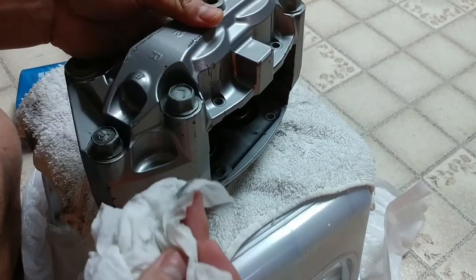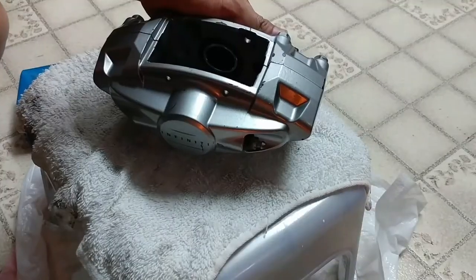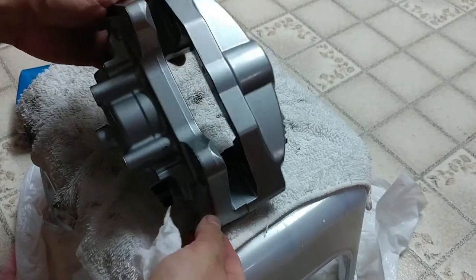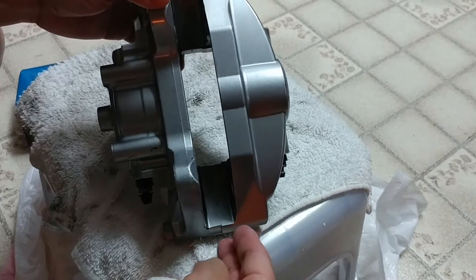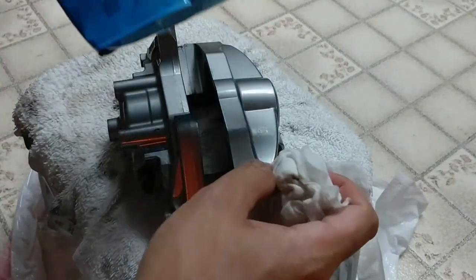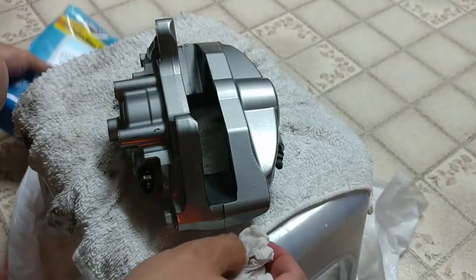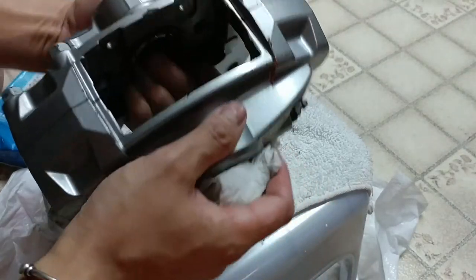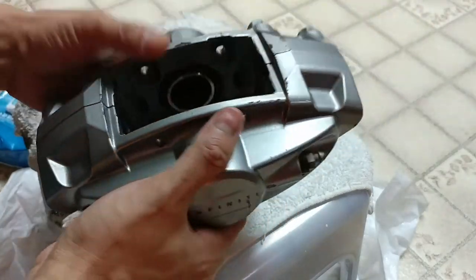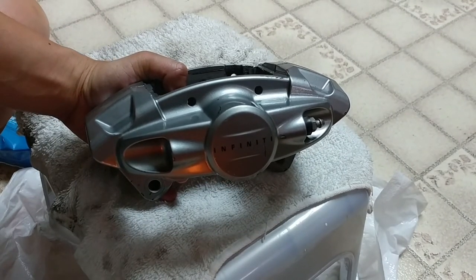This is just one of the first videos I'm going to make - I'm going to walk through rebuilding, sanding, and painting. This one here has a big nick in it that I'm going to get rid of through basic sanding. That's pretty much it for part one. Let me show you the other caliper - the rears. I was able to get this one very clean too using the same process: brake cleaner, soaking in hot water, foam to clean it off, and last but not least the magic disinfectant wipes from Sam's or Costco. I'll come back with the next video on sanding and rebuilding.